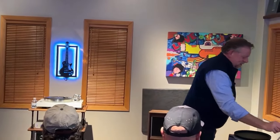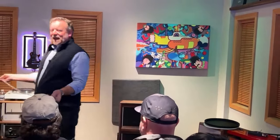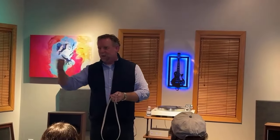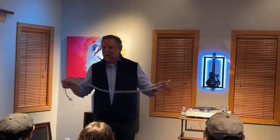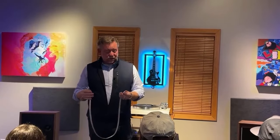One last little thing — actually two, there's just so much to talk about with this table. Even the cable that comes with it is really, really good. I kind of joke — what's the first thing you do when you get an audio component with a piece of cable? Throw it away, maybe tie your trunk shut with it. But this is actually a really solid phono-capable cable. It's not just a cheap plastic-molded coaxial cable — two equal-size conductors for positive and negative, really good quality separate shield and ground. It's about a $70 retail cable, and it comes with any Project table starting at $400.